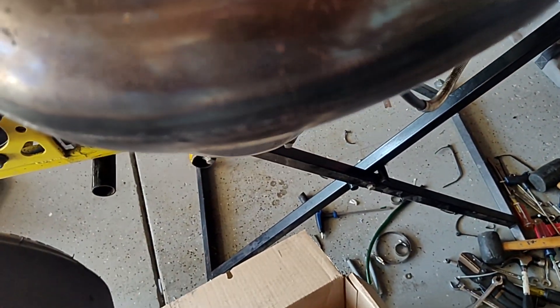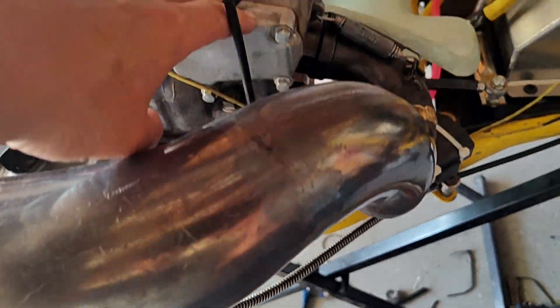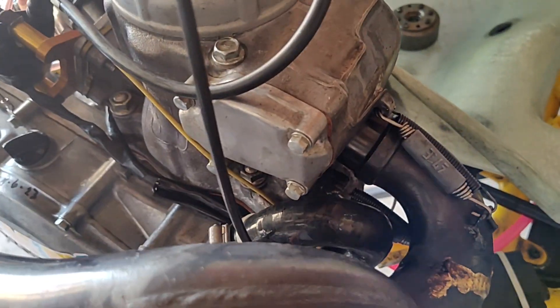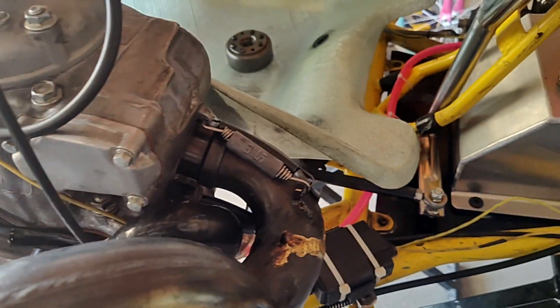I kind of knew that wasn't going to be the issue. Looking inside the cylinder, it looks like they had the power valves locked open — whoever did that, it seemed like a nice job, not a big issue there. Piston and cylinder didn't have any damage, no debris. The spark plug looked good — it looked rich, but that was about it. Nothing major.